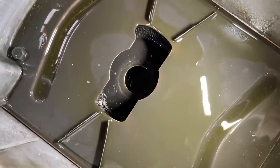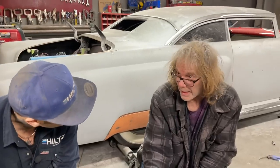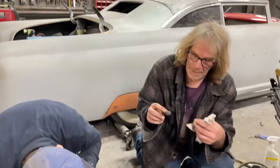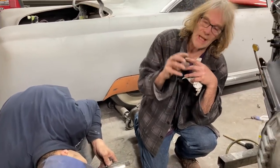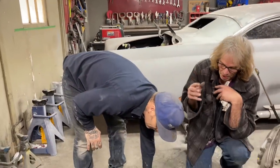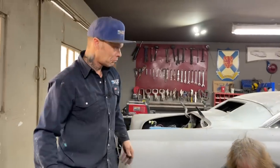Poison. It's over. Yeah, poison. You wouldn't have that much metal in a brand new engine, and you shouldn't have the metal in the oil pan. It should be in the filter. The oil pump picks up oil from the oil pan and sends it through the filter. Every bit of the oil is filtered, which means the filter picks up all sludge, all dirt. It takes thousands of miles for an oil pan to have sludge in the bottom.